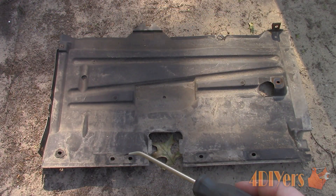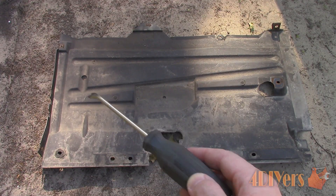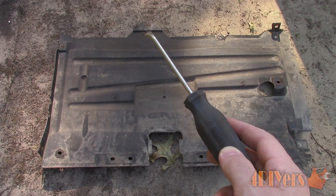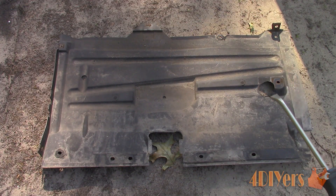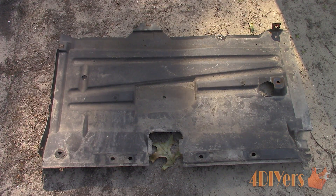For this particular vehicle, here is the location of the expanding trim clips, here is the location of the screws, and finally the locations of the nuts. There will be a couple on the tunnel side of the floor with the exhaust shield, which means you have to reach around underneath the car quite far.